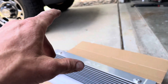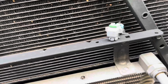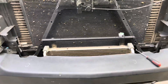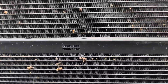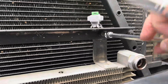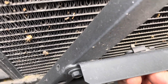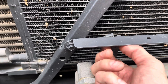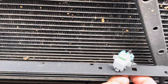We're gonna put a little pan underneath to catch some trans fluid. Looks like we've got number 10 bolts, and then I believe there's gonna be some rubber mounting grommets underneath — we'll get to that in a minute. Went ahead and pulled the cooling lines off — transmission cooling lines, whatever you want to call them. We'll pull these number 10s off with the little ratchet. Sorry I don't have a tripod or an expensive camera yet. I believe we just turn these off and retain the little clips. Go ahead and pull these out and pull this unit out.